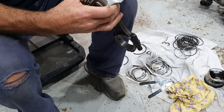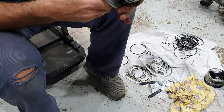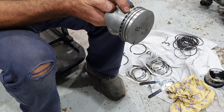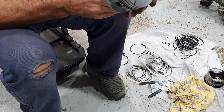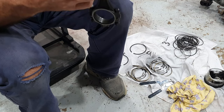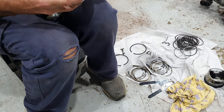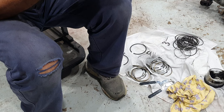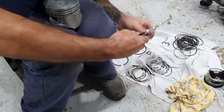The piston ring pliers don't work on that little skinny ring. So you can see there's the block there. The other red one was in that gap there, and I can still see the ends butted together. So right now my spacer joint is there. I have my top ring now at a 45 from it. I have my bottom ring now, so they're kind of spaced. Oil ring spacers there and the butt joint right there. So that's how I like it. Again, everyone has their particular way.